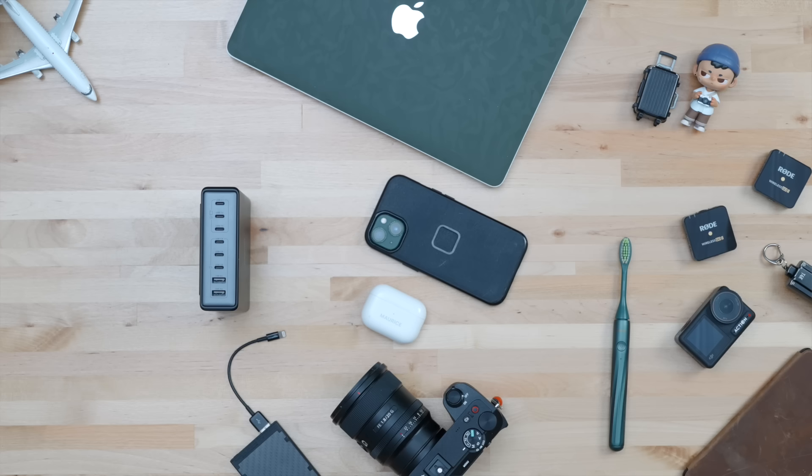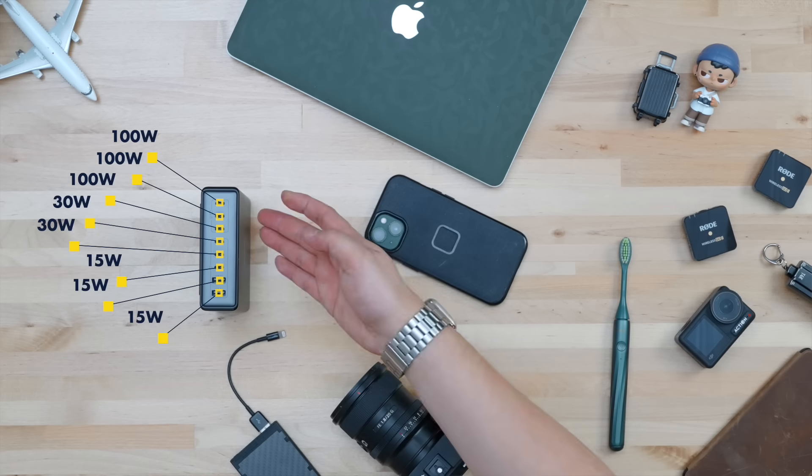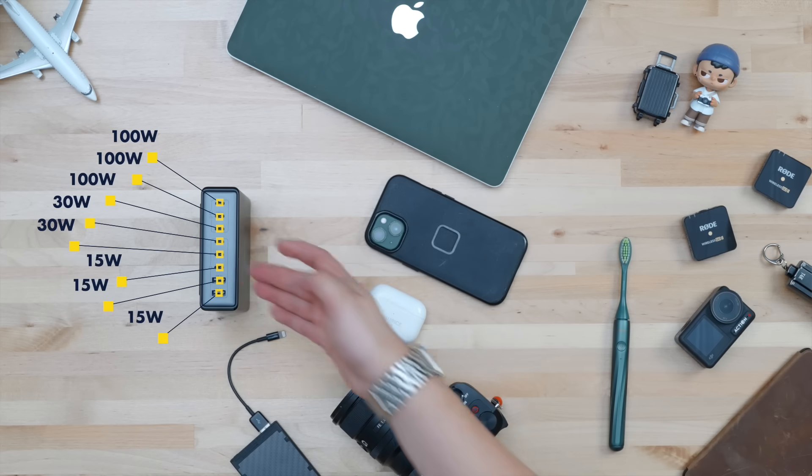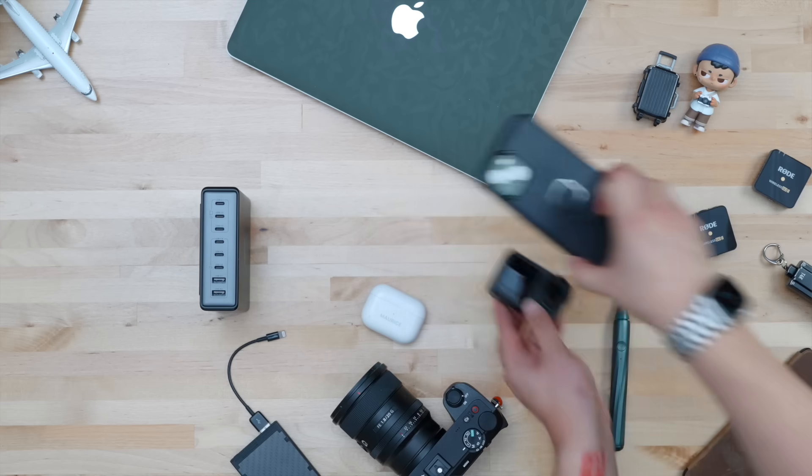Flipping the brick onto its back and zooming in, we can see that the top three ports — USB-C 1, 2, and 3 — are each able to push up to 100 watts, though they cannot all push 100 watts at the same time since the entire brick maxes out at 200 watts total simultaneously. Ports 4 and 5 can max out at 30 watts each, and the last Type-C port as well as both USB Type-A ports all max out at 15 watts each. With each port's max potential output, it makes the decisions easy: my five nightly simultaneous charging devices are confidently covered, and for sporadically charged items I can swap them in and out as needed.